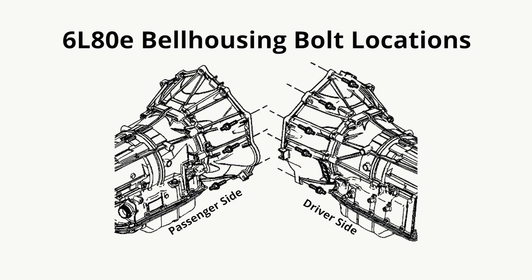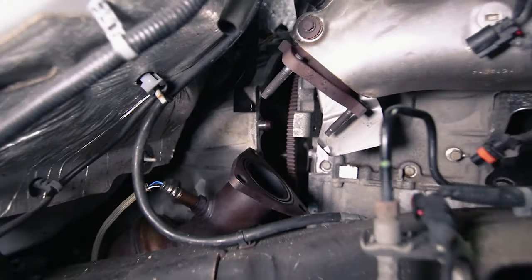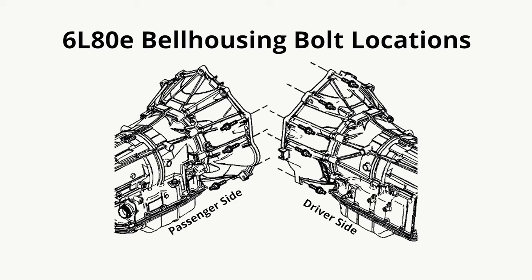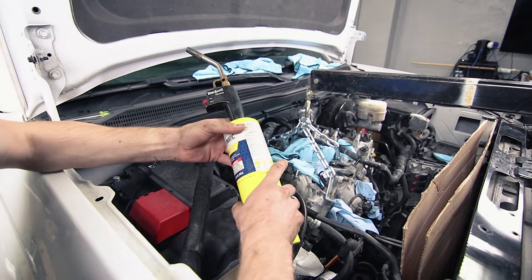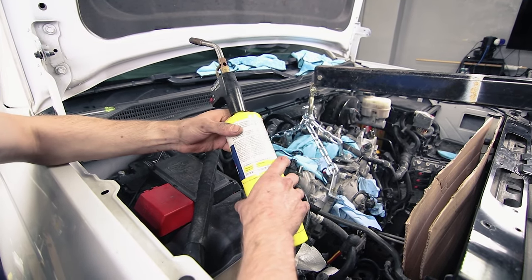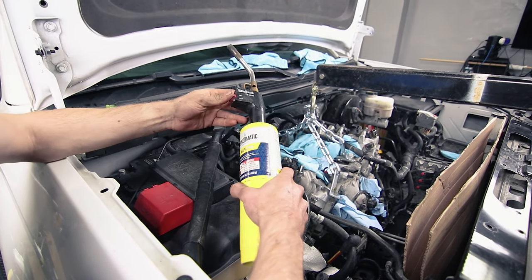Now there are at least two pins, basically midway up on both sides. One is right above the starter, and right about the exact same height on the opposite side, on the driver's side, is another pin. We took a torch and heated those up. We did see one video online where they heated up those studs, and that definitely helped break those free from the transmission. So we heated those up and kept doing that repeatedly.